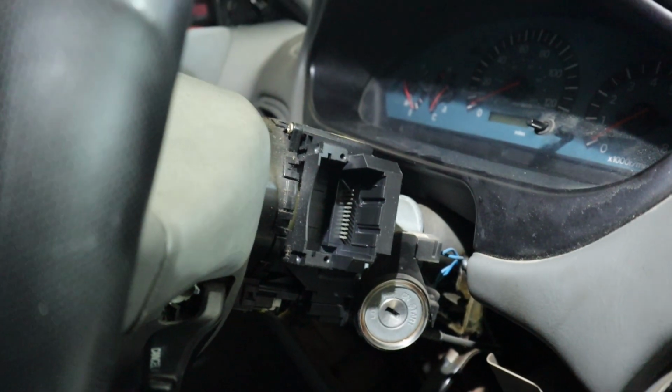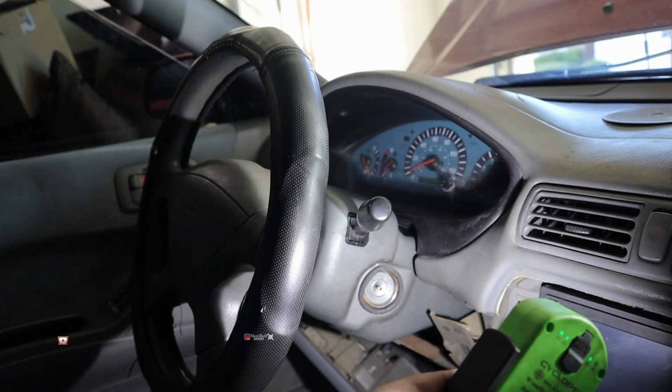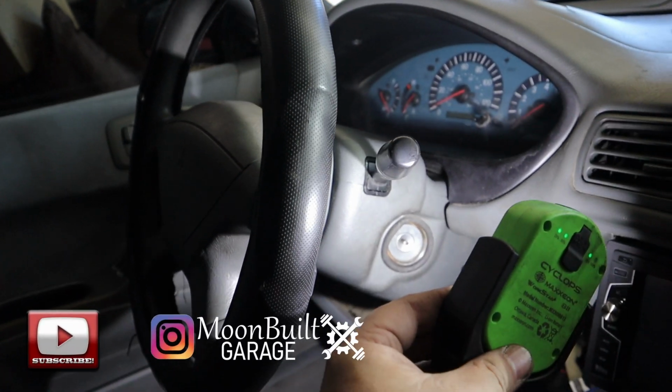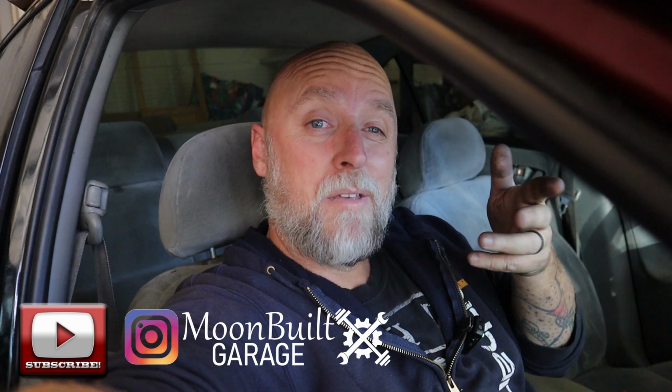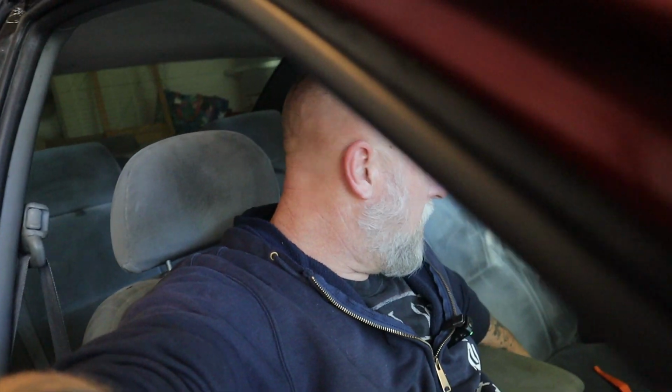And it's the same thing on the other side for the turn signal stalk. And then we just put it all back together. And there we go, the trim back on. This job is done. So yeah, replacing both the turn signal and the windshield wiper headlight stalk, pretty simple. It's just those 2 clips. The whole thing slides out as a unit.